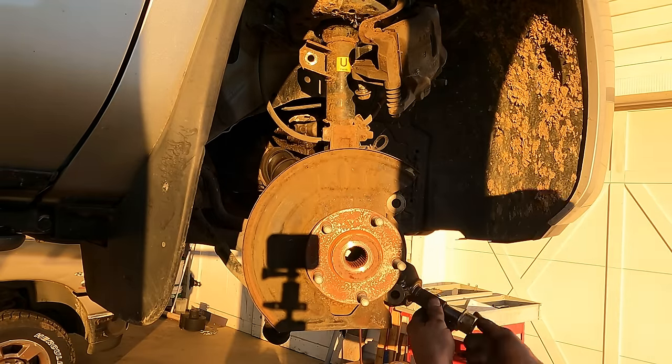That belt is awfully loose. The carnage doesn't look as bad as I thought it would. If you look down there, you can see there's a bunch of bits of metal. There's little chips of metal here. I can feel them, and I think it's coming off the belt. Usually the belt is what fails on these. The belt is made of multiple spring steel bands that go around and are through these plates that give it its shape. But this belt is slipping.